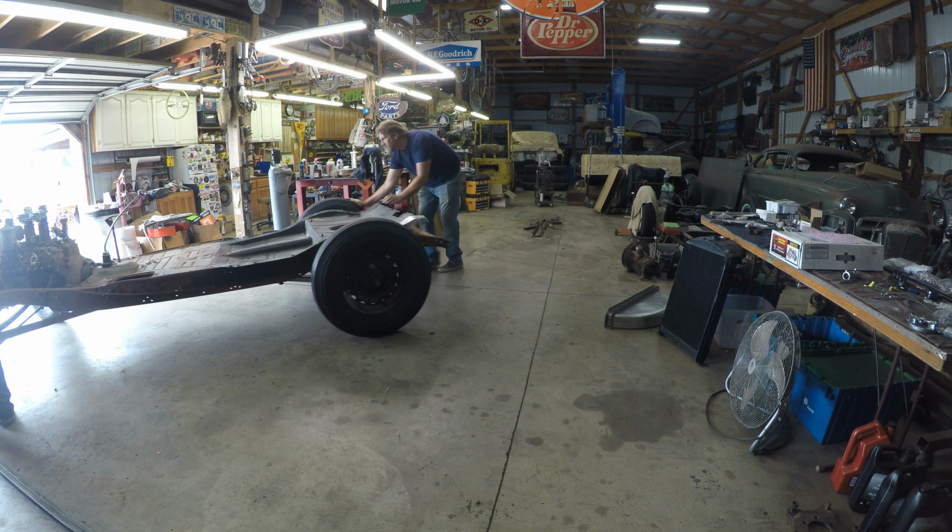The sheet metal floor actually goes underneath the sub. This is the sub floor or sub rail, I guess you'd call it. And the sub rail runs all the way full length. So you have to patch that floor part first and then patch the outside part. So I made me a little dimple die to dimple those holes to keep that off of the frame. That way air can get up in there and it can dry out.